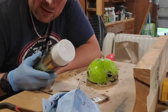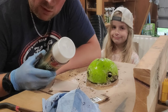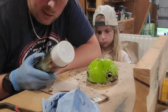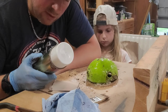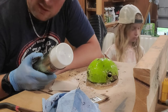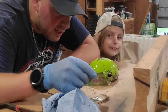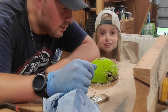Allow time, 5 to 10 minutes, for remover to work. Do not rush job. Test a small area to see if finish is ready for removal. Then scrape off loosened finish by gently working in the direction of wood grain. Is this thing made of wood? No. With a chemical resistant plastic scraper, wipe off sludge with rough cloth or medium steel wool. Repeat application if finish is particularly stubborn. Well, I think we are in the particularly stubborn category, but it hasn't been 5 to 10 minutes either. I don't think we should let this video keep going for 5 to 10 minutes, though. Maybe we'll stop it. We'll be right back.